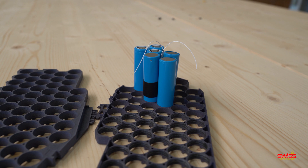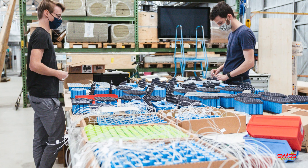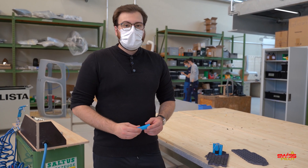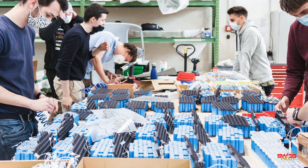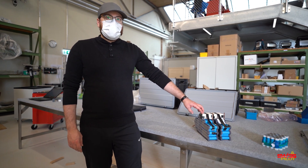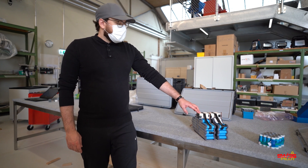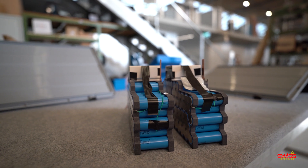These are the battery cells we are using. They're 21700 cells from Samsung — state-of-the-art battery cells with a very high energy density of over 260 watt-hours per kilogram. These here are the bonded battery packs. We have 19 packs side by side in each wing, giving us 38 kilowatt-hours of energy in the wings. Further, we have approximately 15 of these battery packs in the nose.